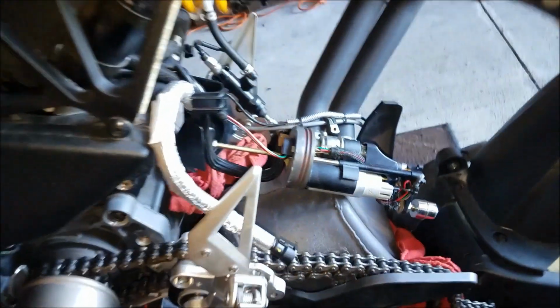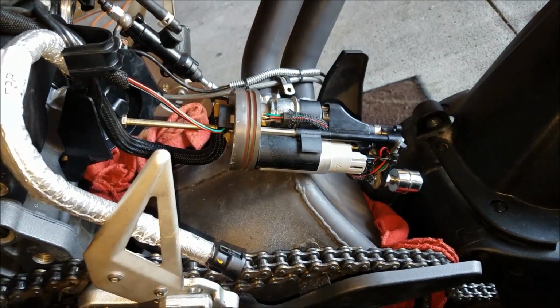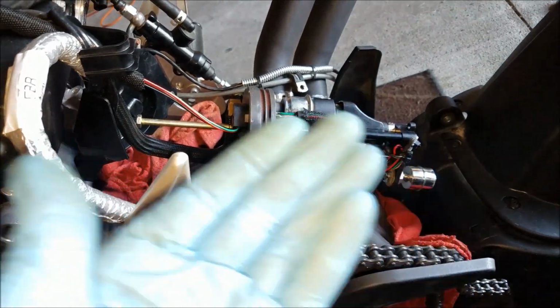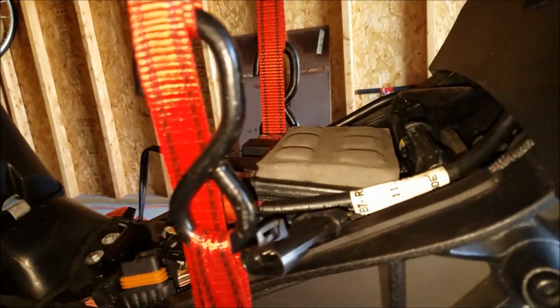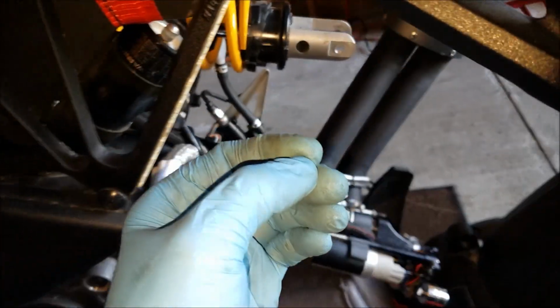Alright, just as a side note, whenever you're testing this fuel pump dry, be careful not to overdo it because you can easily burn out the pump, because the fuel is actually the portion that keeps the pump cool. It lubricates it. Now, also, when you drain the gas out, you're dealing with fuel vapors and all that stuff, and also electrical systems whenever you're poking around testing.